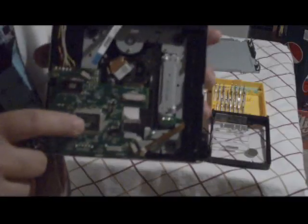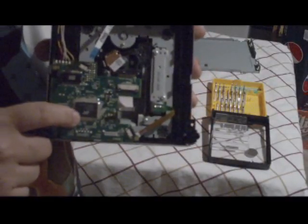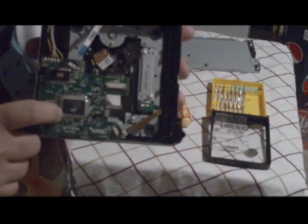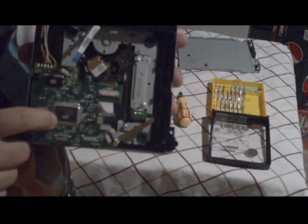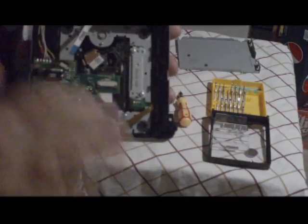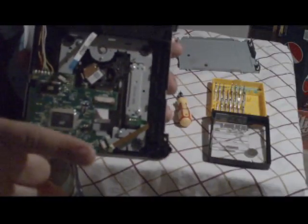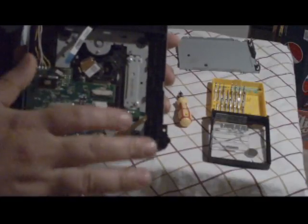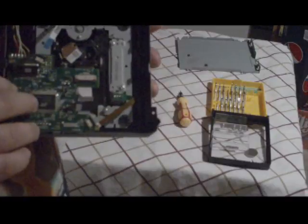This is the board and the chip. When I told you about that flash key, that flash key is like a password to the Xbox 360 to say, hey, I belong to you. You belong to me. Let's work together. So without that flash key, if you just put any blank DVD drive in, it does not work with the Xbox 360. You will brick your drive, so make sure you look at future episodes. I'll show you how to not do that with the hacking and cracking of the other Xbox. But for now, this one still works.